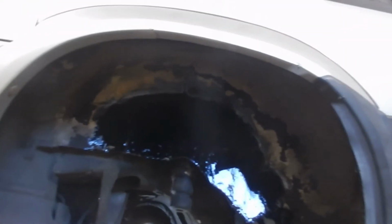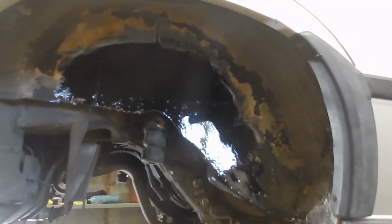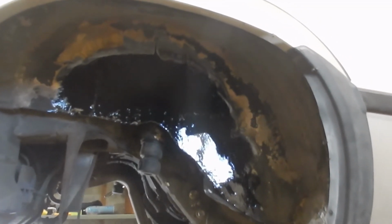Hello. So the passenger side hole has now been patched. I put what was it, 1/16 gauge steel there, and welded it all in and covered it in POR-15. And then after that, I'll undercoat it, clean it up nicely, and it'll look perfect. So here's the finished product. I hope you can all see that pretty well there. It's nicely done. It's 2 patches, due to all the curves and bends, it just made it easier.